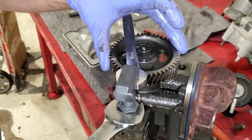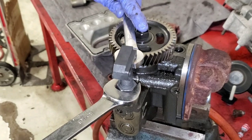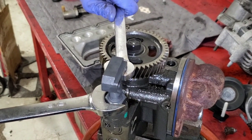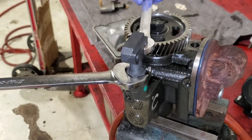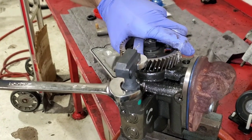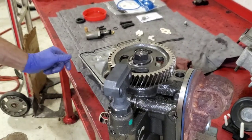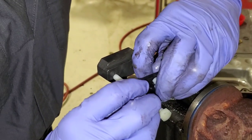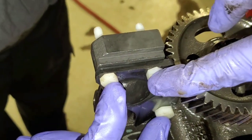You guys see where I've got this wrench against the gear bolt — I'm going to use that so it's not going to allow it to turn. This is supposed to be 49 foot pounds. I'm going to go ahead — they want you to use a crow's foot and I don't have a crow's foot, this is how I've done it. Just tighten it pretty much totally until it can't go anymore. Then we come back to our alignment plate and try to put this back on just to verify our straightness. You guys can see — we got no air gap right there, so we know we're good.